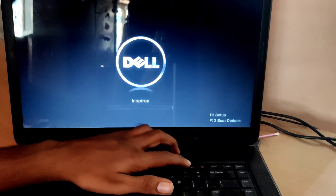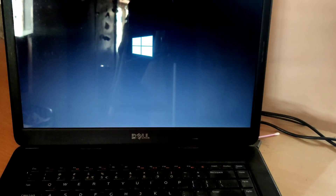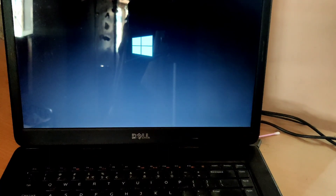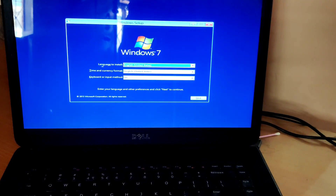Turn on the PC and tap F12 to enter into your boot menu — for your case it may vary. Now select USB storage device. The USB is successfully booting. It will take a while to boot up. My Windows operating system is successfully running — the Windows 7 installing window is showing. The pen drive is successfully bootable.